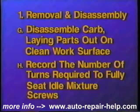Before removing the idle mixture screws from the carburetor base, turn them in until they stop while counting the number of turns, and write down this number. Retain all gaskets to match up with the new ones for correct replacement.